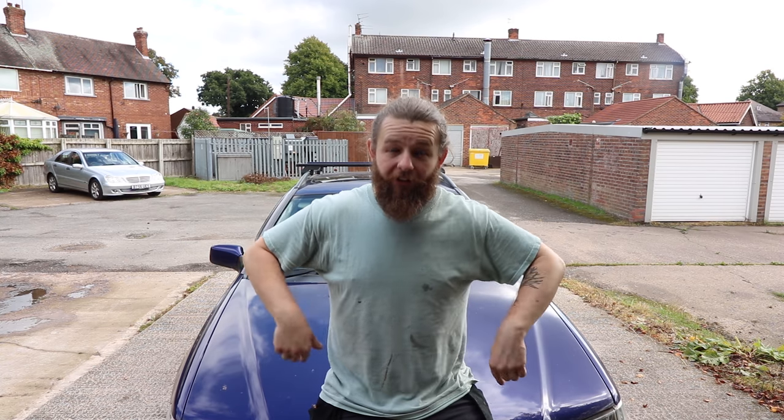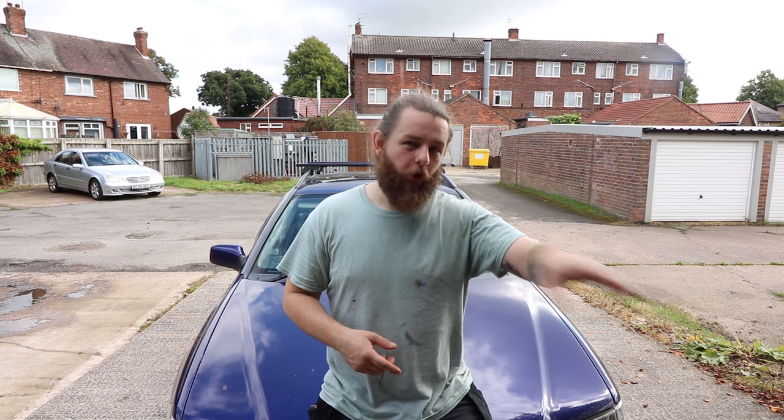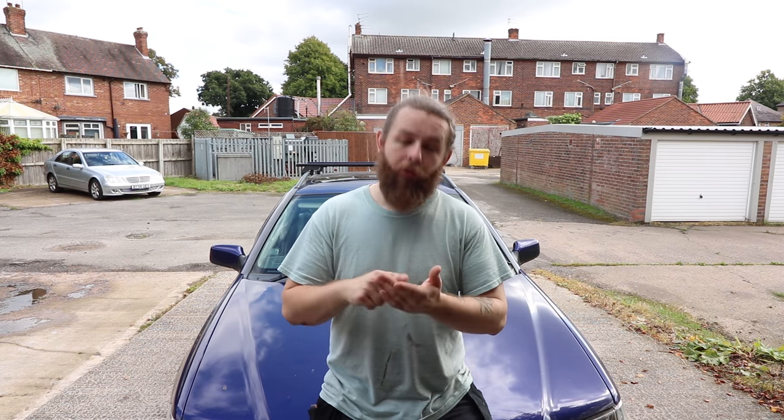First, what I'm going to be doing today: the oil pressure light keeps flickering below certain revs. Apparently it's quite common for the pickup pipe in the sump to get clogged, because the strainer's only a tiny little hole. So what I'm going to do — I was going to service it anyway because it hasn't been serviced in a while — I'm going to drop the sump. We've got box parts, we've got a new oil pressure sensor. I'm going to drop the sump, clean the pickup pipe out, put a new sump gasket on, reseal the sump. We've got an air filter, we've got a fuel filter, and then we're going to see if that has solved the issue. If so, we're going to go on to the rest of it, because if the engine's bricked I don't really want to do anything else to it.